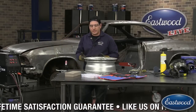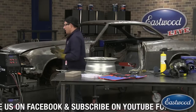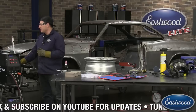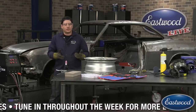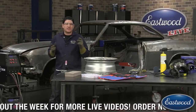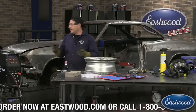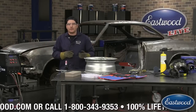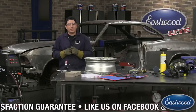Ben Koster asked: what series aluminum is the wheel, and how do you know to choose a similar filler rod? The aluminum in the wheel is really difficult to figure out unless you can go right back to the manufacturer and see what it is. A nice mid-range filler rod to use — like what we're using today — is 4043. That's a good mid-range that will play friendly with most of the wheels I've found. If you want to match it exactly, even if you found out the wheel was 4043 and you used 4043 on it, the 4043 may be slightly different because it was made at a different time, might be a slightly different grade, and what the purity was. So if you went to polish this out, you'd always see a slight difference in the hue of the repair area.